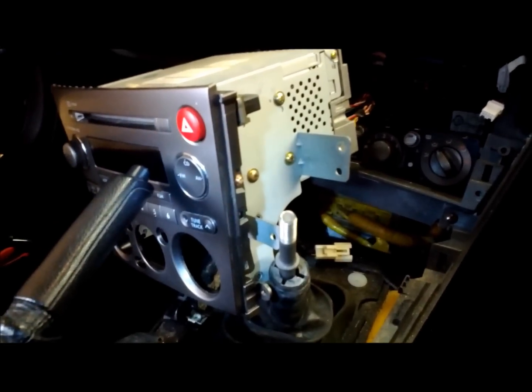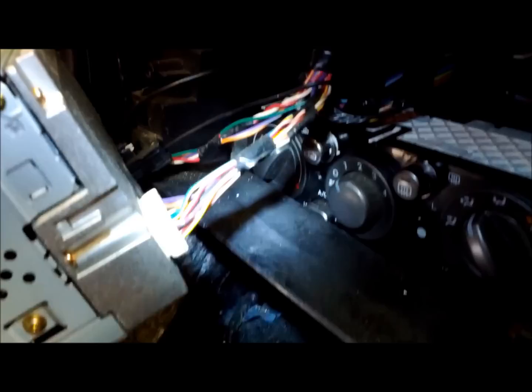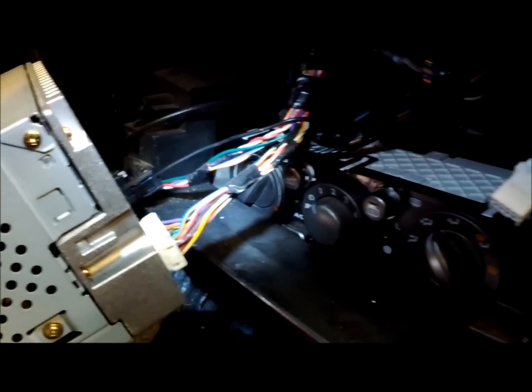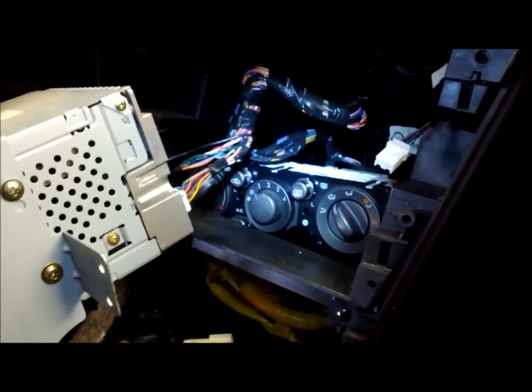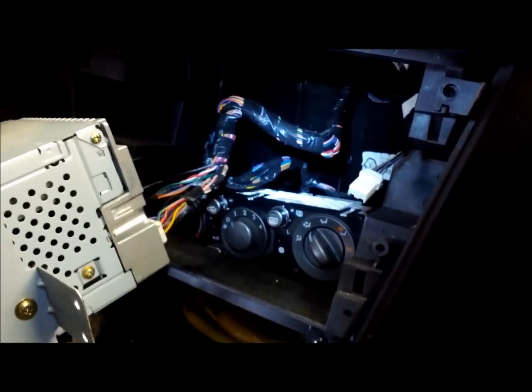As you can see, I separated the climate control from the radio bezel and pushed it back inside the car. Next we want to disconnect this white plug, this black plug, and the little ground — they're just little push pins. You might want to use a little flat screwdriver for the ground plug, as sometimes it really sticks on there. Then we'll be able to move the radio more towards the driver's side floorboard, which will allow me to find the wires I need within the harness to do this splice.